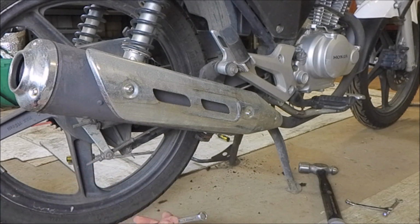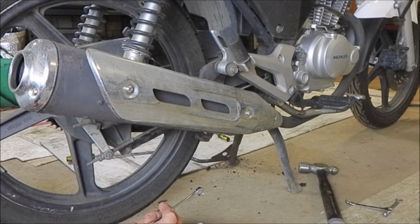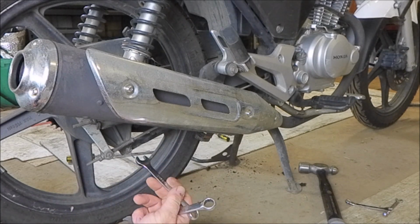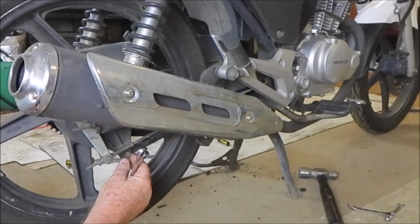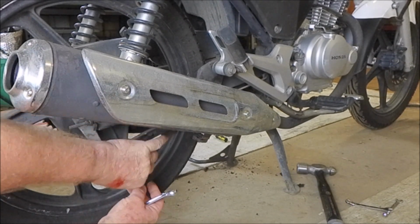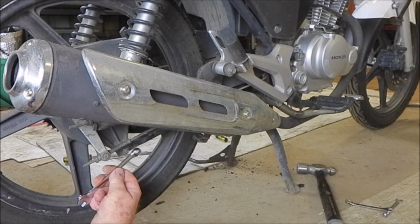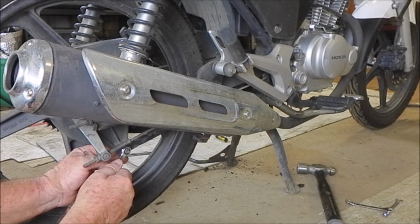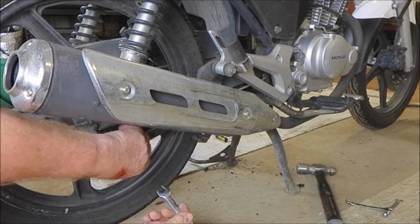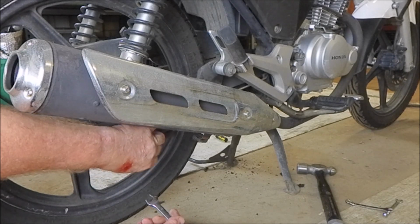And finally, we have to take the axle out, or else the back wheel will not slide off. So there's a split pin on the stabilizer bar. Mine comes off quite easily. And that, of course, just stops that nut from coming all the way off, because that brake backing plate, if that was to ever spin, that would cause real problems.